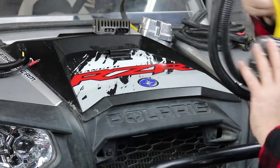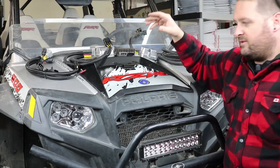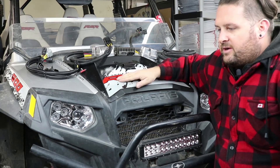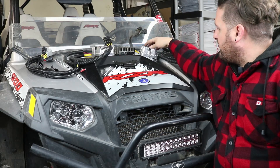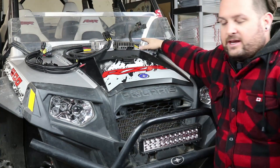If you've had one of these for long, you've probably had a regulator failure. They are notorious for it — it is very common. They're mounted in a really poor location in the rear fender well area, and it's very common to get the fins on the regulator packed with mud. They can't stay cool, so they overheat and fail.